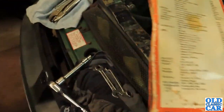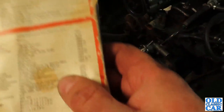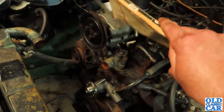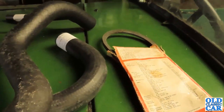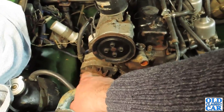I found a new old stock fan belt — a proper V-belt, not been used before. Looking through the British Leyland catalogue: MGB 1800 GT, 1962 onwards. Hopefully that'll fit. The air compressor has its own separate belt which I won't bother putting on — it has a twin pulley for two belts. The one that was on the car was one of these horrible modern toothed belts, not very nice, so we'll put a proper one on. All I need to do now is put the air pump back down, put the fan belt on, readjust the alternator belt, and then do the hoses.